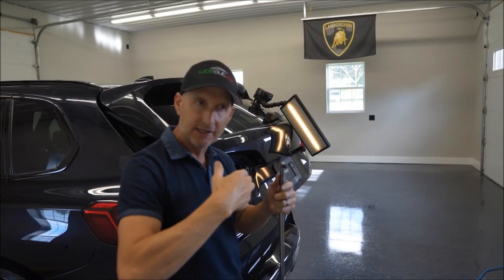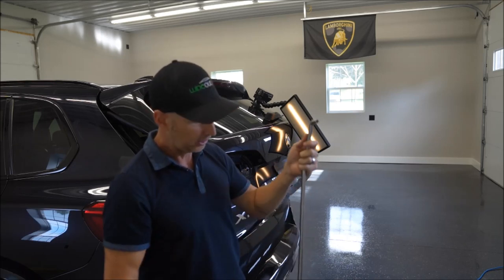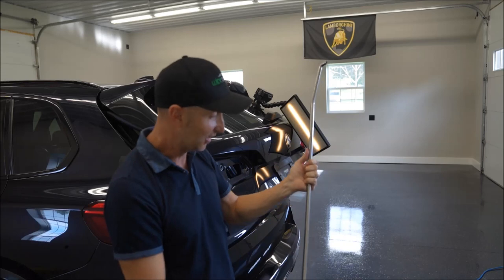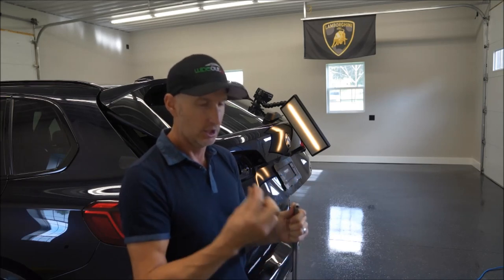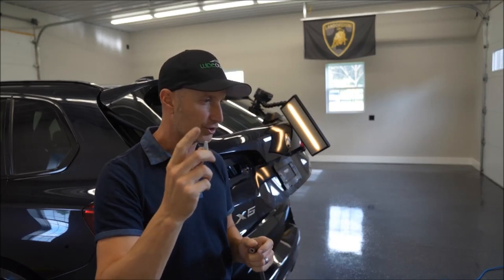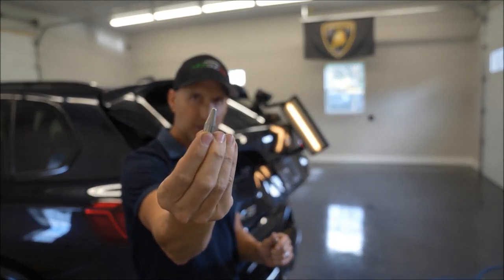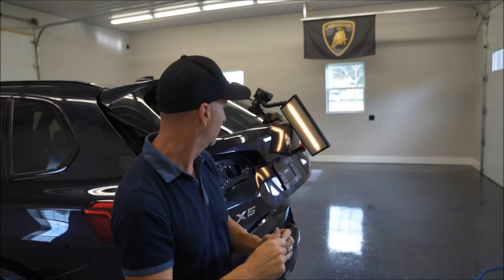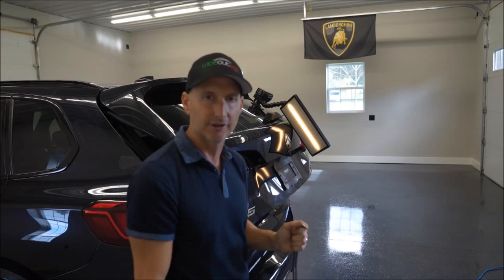Alright, as I mentioned we're kind of done getting out most of the deepness. I'm going to switch up the tip here — that's why I like these Ultra Dent tools. This is a pretty big double-bend rod, and you can see the leverage I'm getting on it and it still gave me a lot of trouble. So we're going to be done with the rubber tip, take that off, and put on a metal tip. I don't want a real sharp tip yet — that tip should be good enough to get to those low spots. I'll be heating it up and just going in to get out some of those low spots with the metal tip.